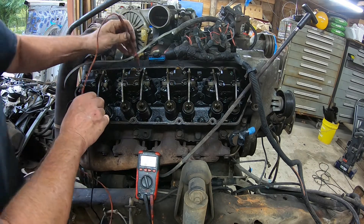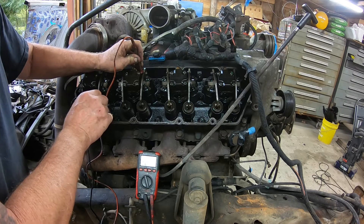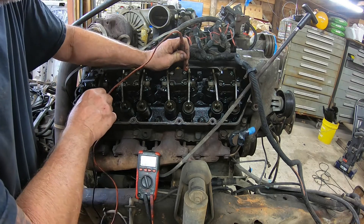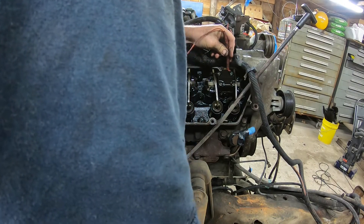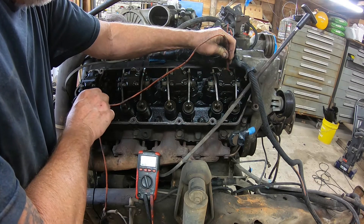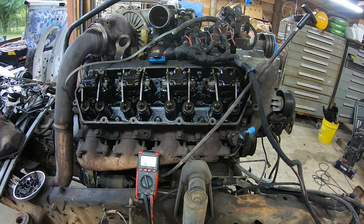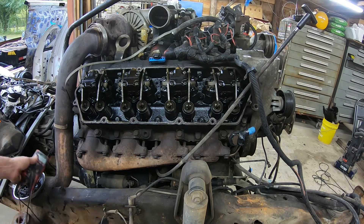That's K-Ohms — that one's no good. K-Ohms — that's no good. They should be a really low resistance. K-Ohms, big Ohms — I think I'm just going to get a set of eight. Oh, here's a good one: 2.8 Ohms. There's one good one. You've got three bad on one side — probably going to have the same thing on the other side. I'm just going to order it, just get a set of eight.